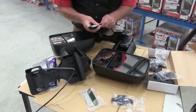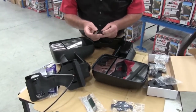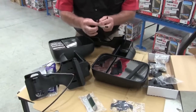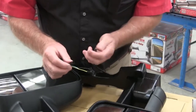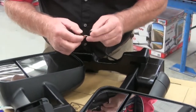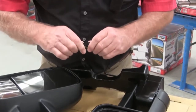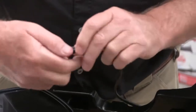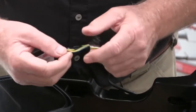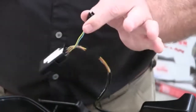You must have these brain boxes, or circuit breakers, or whatever you want to call them, plugged in. You'll find that there's a plug with four wires in it, and there's another one with two which goes back to your switch. Make sure you put these in, and you get them on the right way around, and make sure that it's all the way home. Otherwise, your power fold won't work. Once you've got that in, that runs back to your switch and your button and everything, and Bob's your uncle — away it goes.